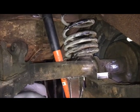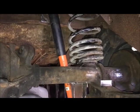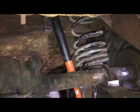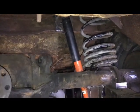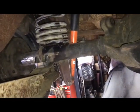So if I wanted, I could change these spring mounts. Instead of having them bolt into the car, I could put cups on the rear and on the top like they did in the late 60s, so the springs pretty much just sit in there. You don't even have to use a wrench to take them out. You just take the shocks off, lower the axle. But I think this will be fine for now. But that's it. We're done.